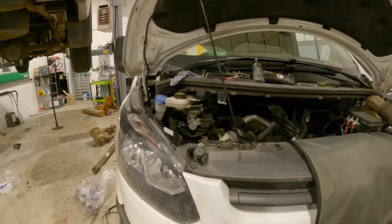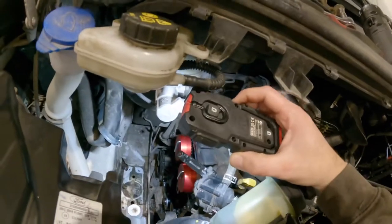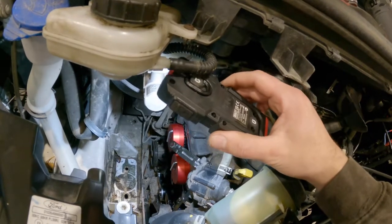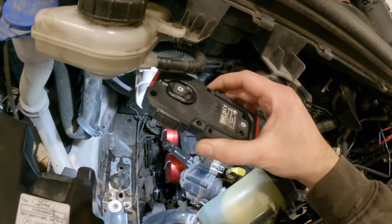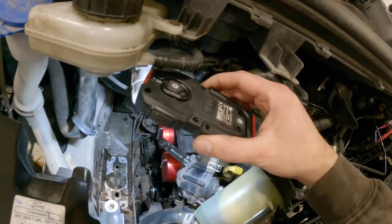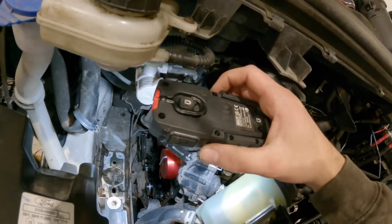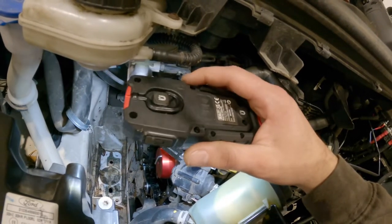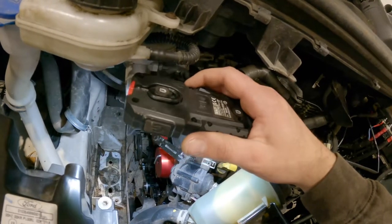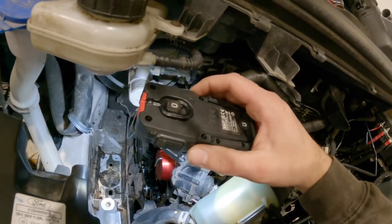Now these engines rely heavily on servicing and the correct oil. These engines have a timing belt, not a chain — they call it a wet belt, as it runs behind the timing cover, so the belt itself is behind the timing case getting covered in oil all the time. That's not an issue providing the vehicles are serviced on time and use the correct oil. I've got no record of service on this vehicle, so I'm not 100% sure if it's been done correctly.